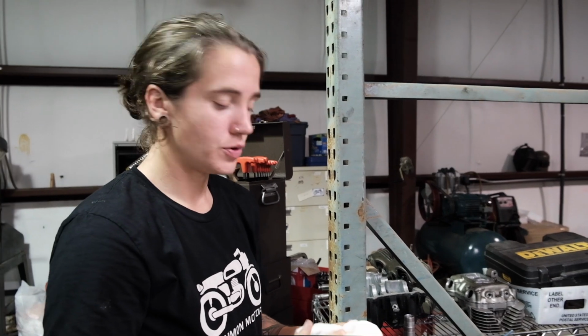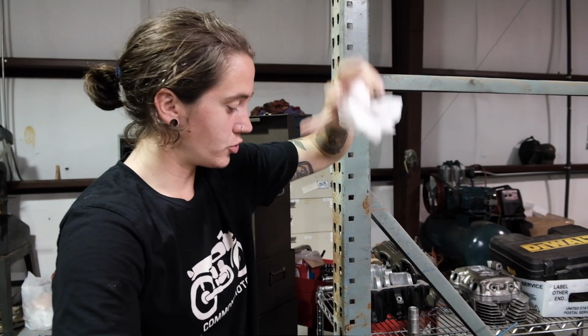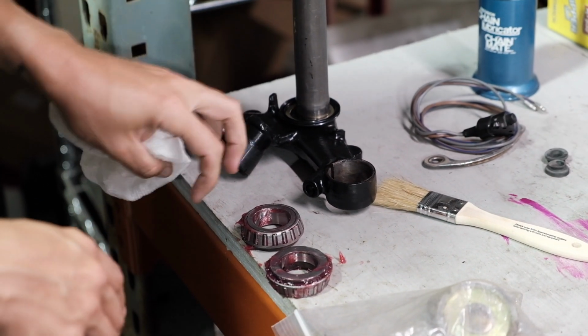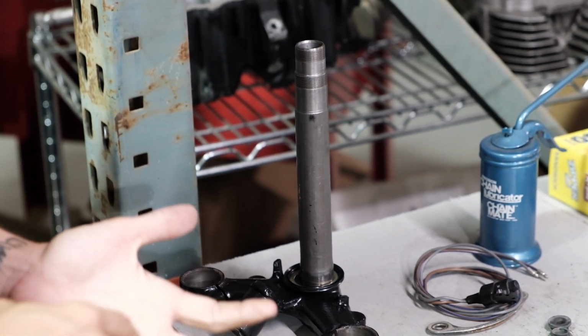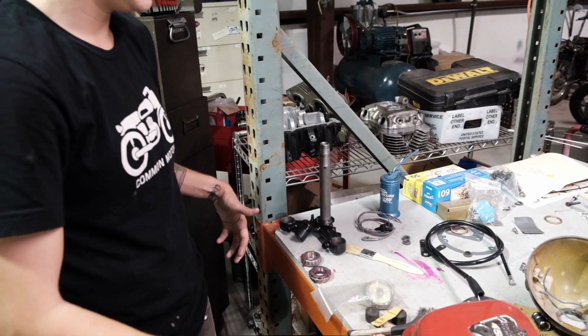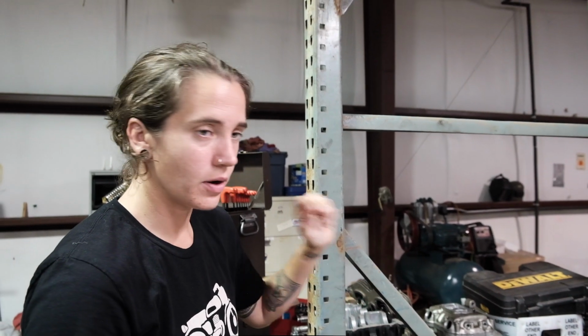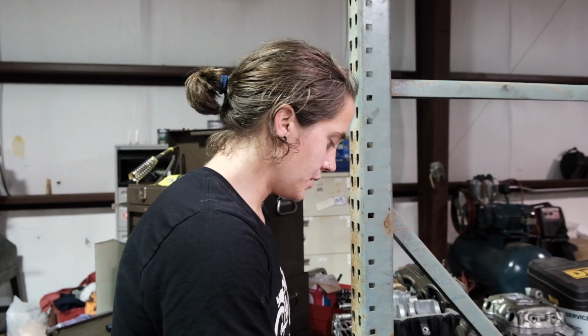So I'm getting ready to fully put back together my steering bearings and my triple tree. Before we put them back on, we packed them with grease. They do not come pre-packed, so you have to glob in the old glove and pack it in. We have videos about that. They're going to be linked down below. We also are going to link below a video about the fork rebuild, so you can do it with Brendan's guidance. Yeah, so we're going to drop them into place.